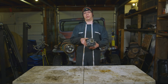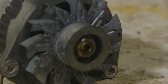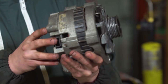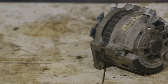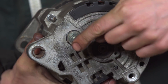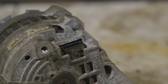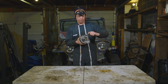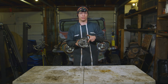Now that we've got this alternator out of the Firebird, we can have a closer look. On the outside of the casing, we can see the pulley, which is driven by the serpentine belt, and which spins this external fan. That fan sucks air in from the back of the alternator, cools the diodes and windings inside, and exhausts that hot air out of the front. On the back, we can see some terminals — there's one between the alternator and the battery, which is how your battery gets charged. The other connection has terminals inside like the sensing terminal, which communicates your car's electrical load to the alternator, terminals for things like your tachometer, and a terminal for your field current. We'll get into what that is when we crack this thing open.